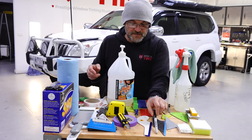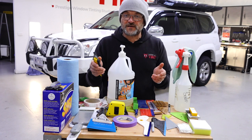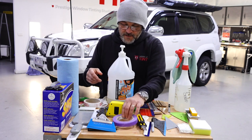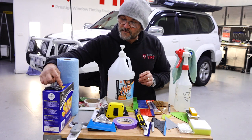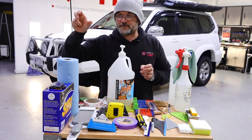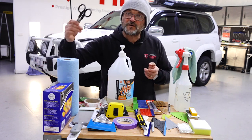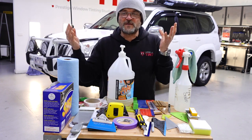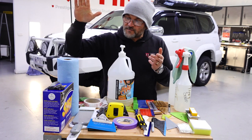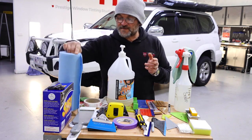I use a Sharpie — we'll go through that at some stage for rear screens — and some tape. I've got a large Stanley here; we'll use that when I teach you how to shave the top edge of your windows, as certain sections need a larger Stanley. We've also got a tape measure. Steel wool is great for cleaning rear screens or sections where you've got micro dots — the black dots that run down the side of frameless cars like BMWs. I always cut steel wool off with a pair of scissors rather than tearing it, because tearing sends fibers everywhere and creates more contamination. Every time you use steel wool, mop up or clean the window with some paper towel before you squeegee the glass.